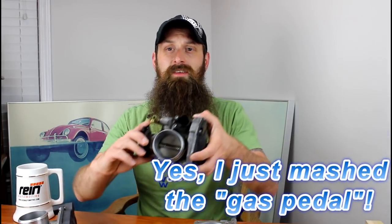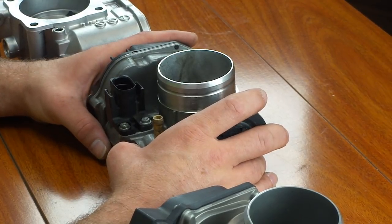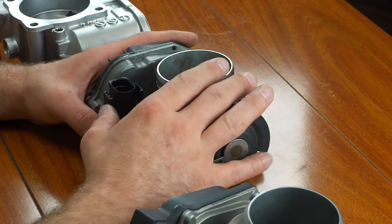Let's start by talking about what the heck is a throttle body. Basically, a throttle body is going to allow more air or less air into the engine. This is largely based on driver input — your input on the accelerator pedal. And the ECM will be able to compensate for certain things like small vacuum leaks, wear on the throttle body, or even dirt built up in the throttle plate.